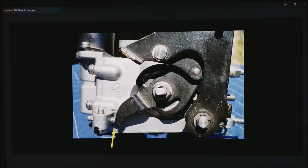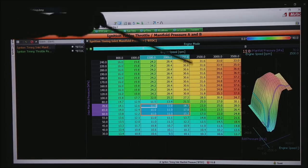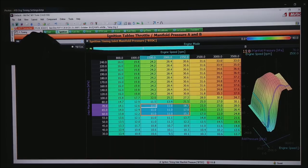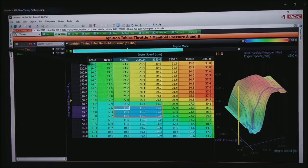So now we're going to look at the ignition table for this particular motor. When I opened it up, I found that from 60 to 70 kPa and between 1500 and 2300 RPM is where this motor was idling — the hunt was down through here. I had the least amount of timing when the RPM was too low, and was adding timing when the RPM was too high — just the opposite of what we want. So we're going to flip these numbers. My target idle is about 1800 to 1900 RPM on this motor. I added timing if it starts getting low and subtracted timing as the idle gets too high.